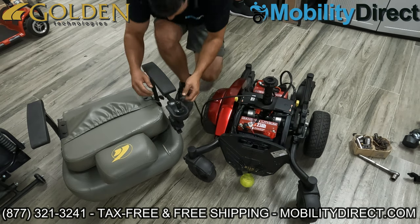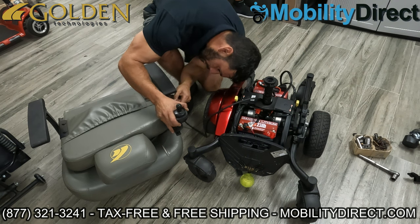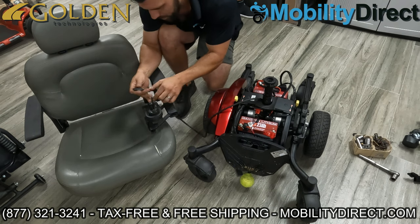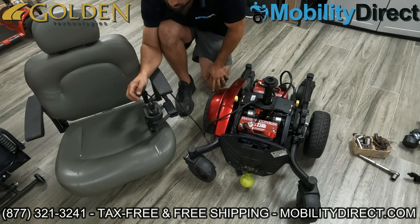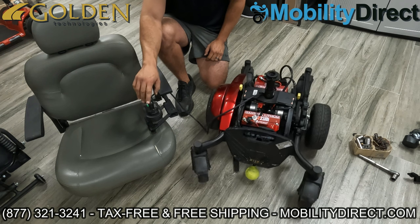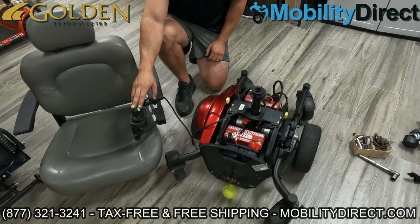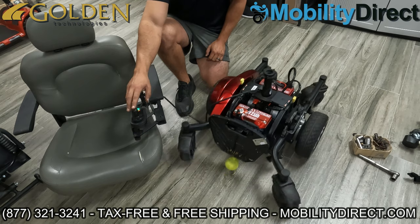What we're doing now is grabbing the cable for the joystick to test it out, to see if when we turn it on it still gives you that fault code where it beeps seven times. It's got a swing-away joystick, so we're swinging it out of the way to connect the joystick cable before we install the seat and put the panels back on, just to make sure it works. I realized I didn't have the brakes engaged, so I had to just turn the brakes on. These units have automatic brakes — I engage the brake levers, reset power, and as you can see, the unit is now moving as it should. Before, it wouldn't move at all; it would just give you that fault code error. So that's it — we successfully fixed the unit.